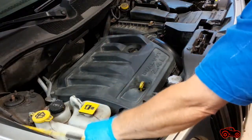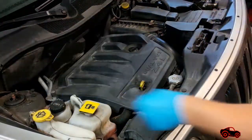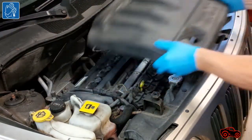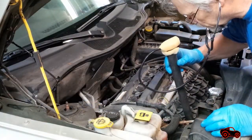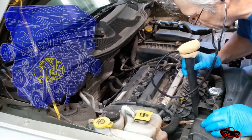In the last 50 days, I noticed a chirping noise coming from the engine or a component around it. To locate the source of the noise with precision, I decided to use my old custom stethoscope. The tool can work with or without contact. In this case, the noise was getting louder near the alternator.